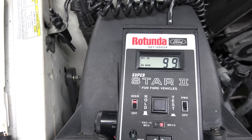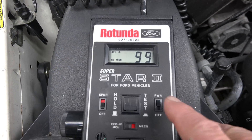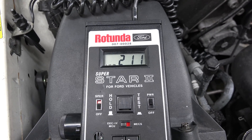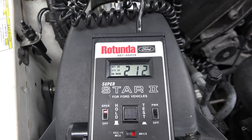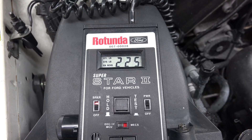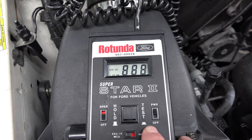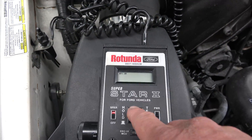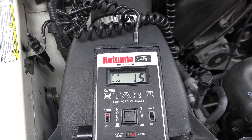I'm expecting to have an error 98 or 99. I had to look up what 99 is - I think it is one of the struts that is a different height than the others. To clear those, I go all the way down to 228, which will clear all codes. I had code 15 - that should have cleared it. Going back to 211 - it should be gone. Yep, code 15 cleared, everything's clear.